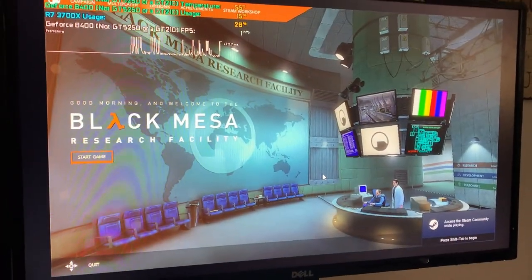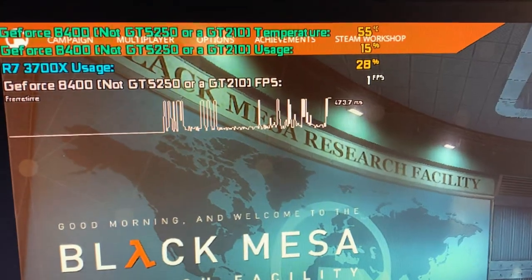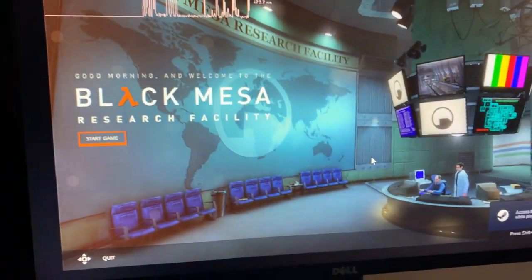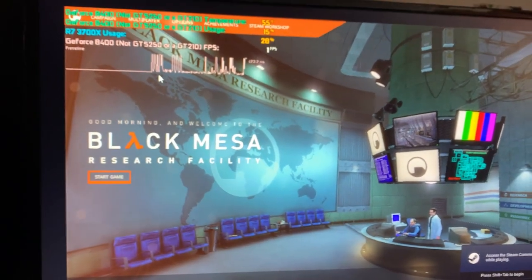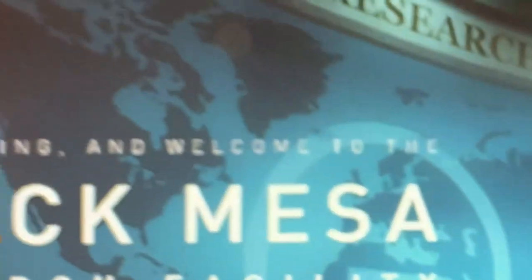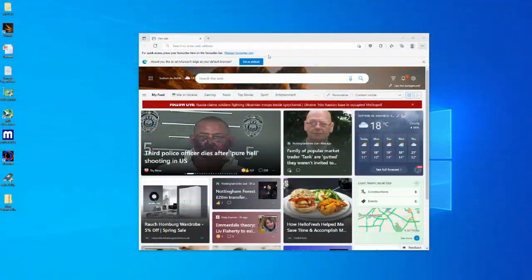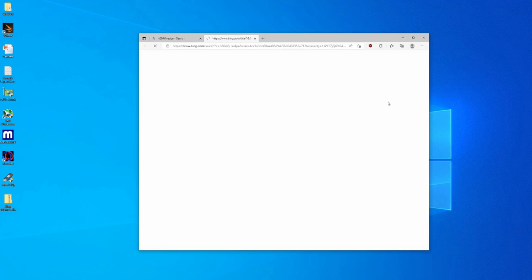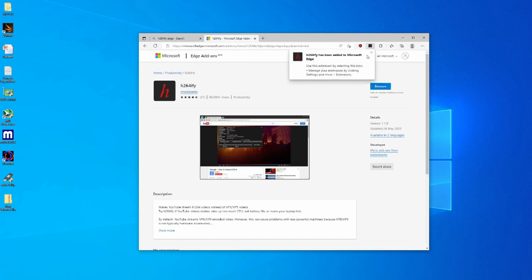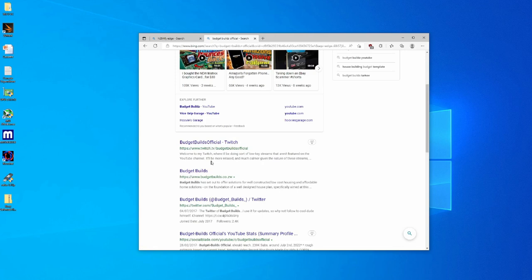Entirely off script — this is what it's like starting most games. This is a source game for reference, and we're in-game. As you can see, MSI Afterburner is running and is working. But it's not doing a great deal — I can move the mouse, push Start Game... doesn't do anything. This is the cheapest graphics card experience, or at least the one that you're getting if you order it from CEX at the moment. Not that it's CEX's fault, but whichever one of their stores sent it to me. In terms of desktop usage, we couldn't even record things properly. Most modern iGPUs will be better, and in terms of cheaper display adapters, we had that Matrox card not too long ago that was far better than this, used less power, and ran far nicer. The only way to get things to work properly was to use optimizing software like H.264ify just to load videos, and even when it came to the desktop, it wasn't that nice using 1080p.